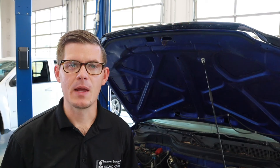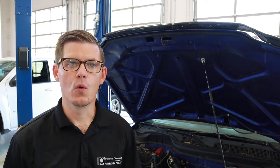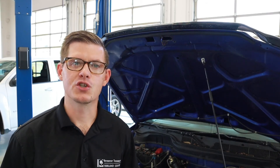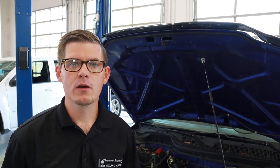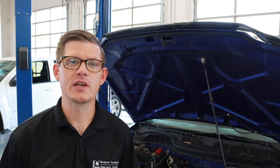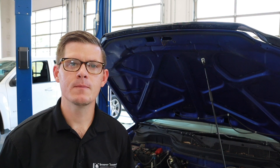Another type of test is a functional test — if I'm worried the oil pressure light stays on, how do I know that's a real low oil pressure situation versus just an issue with the switch? One thing I can check is unplugging the switch and making sure the light goes out, to ensure the signal wire doesn't have a short causing the light to stay on. Ultimately I'd want to remove the oil pressure switch and check real oil pressure with a gauge. Any low oil pressure concern has to be approached cautiously because I don't want to run the engine more than necessary if it indeed has low oil pressure. Those are the basic checks and replacement process for an oil pressure switch — in our case we're hoping it fixes the engine oil leak. Thanks for watching.